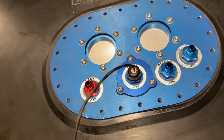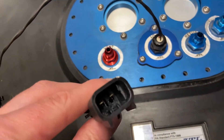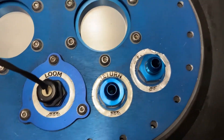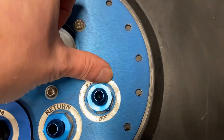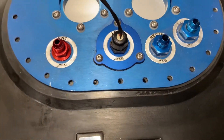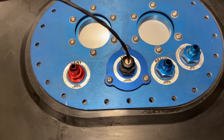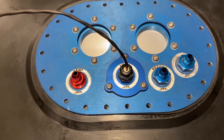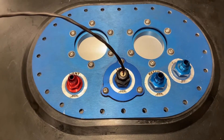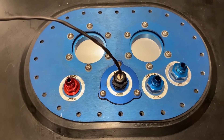That then vents out via a braided hose to the underside of the car. Wiring for the fuel pump — again you'll see the underside shortly, all supplied by ATL. The return line and the feed line. The stick is obviously coming apart there. Dash six fittings — simple supply and return. On my car it's a regulator and also a filter and that's where the return comes from before it heads up to the high pressure fuel pump.